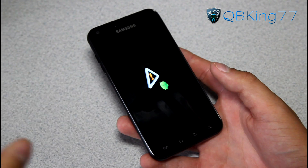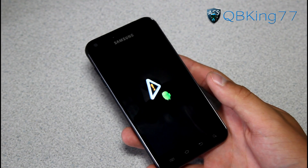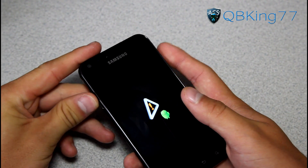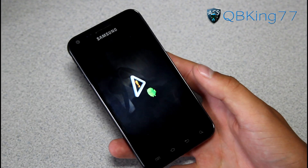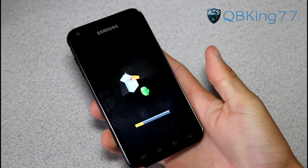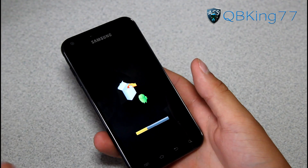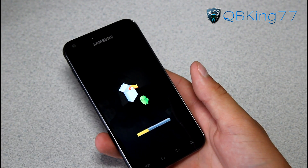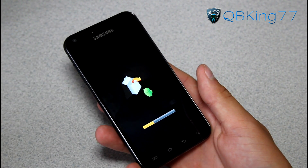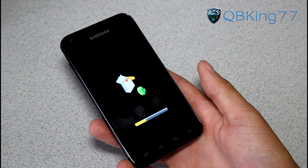The update is actually pretty large, so my guess is it's going to take a bit of time. Make sure your battery is over about 40% just to be safe. It looks like it's sitting on the screen with the Android guy and an orange triangle — it'll probably sit there for a little while while it's loading up the file. It stayed on that screen with the exclamation point for a couple minutes, so be patient. Then it went ahead and brought up a progress bar. It's a large file, so you're going to need to be patient with this update.